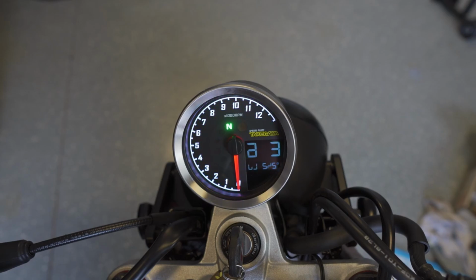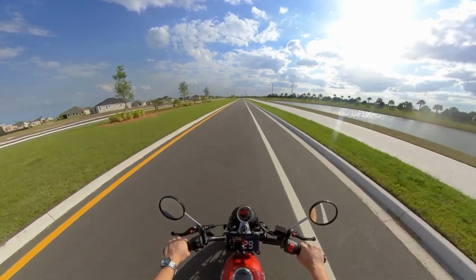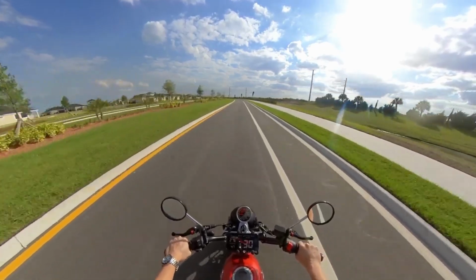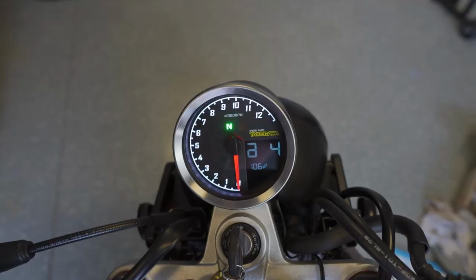And after that, you can also select the intensity, one being the dimmest, 3, 4, and 5 being the brightest. So I'll leave it at the top for now. So this tire function is great. I had an aftermarket speedo healer from 12 O'Clock Labs that I was using. Well, this thing has it integrated, and you can change the percentage of the tire size to accommodate for different speeds. So using the GPS on my phone, I just made adjustments until I got it to, in this case, 106%, which matched up well with my 16-tooth front sprocket and stock tires to give me an accurate reading on the speedometer as it matched against the GPS.